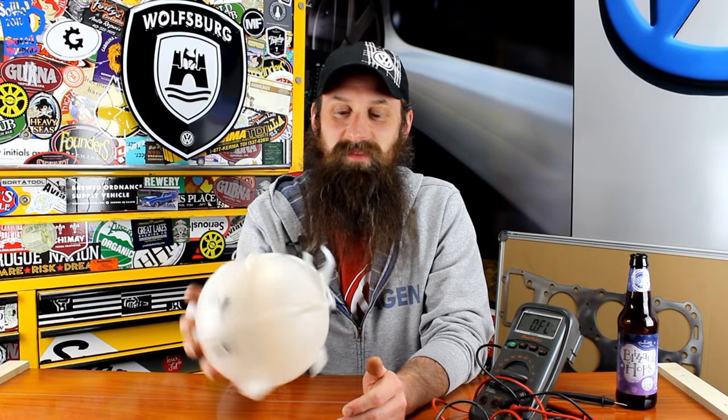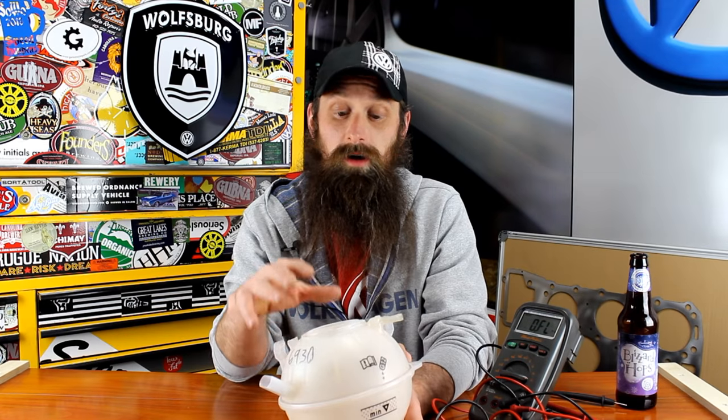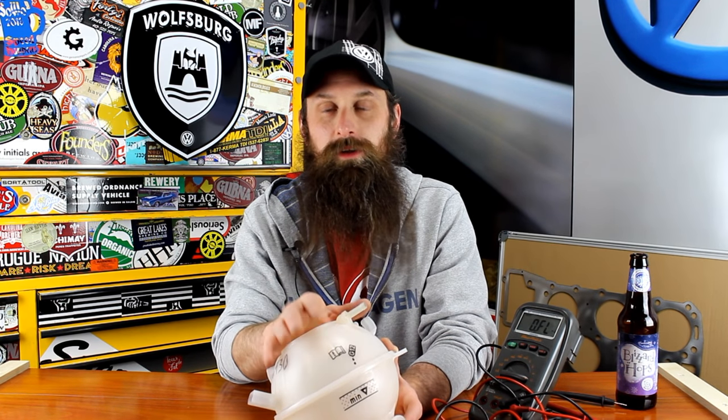Anyway guys, that's it — very simple one today, but they do still fail semi-regularly, not as much as they used to. Also, it's kind of a cosmetic thing — a brand new clean coolant bottle looks so good in the engine bay. I've had plenty of customers who go ahead and do a new bottle just because the old one's all crusty, even if the contacts aren't terrible. I also have one little trick: if you're having the issue where the red light's flashing, the level's good, and the car's not overheating, you can actually bend the prongs in just a little bit inside the bottle and that'll change the resistance and make it work for a little while. But once you start to get to that point, I really do recommend replacing it — they're not that expensive and it's an easy DIY.